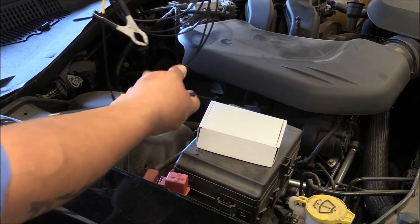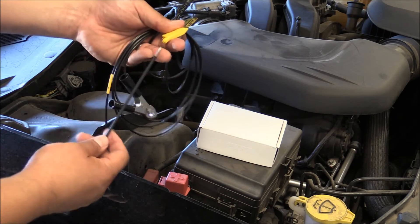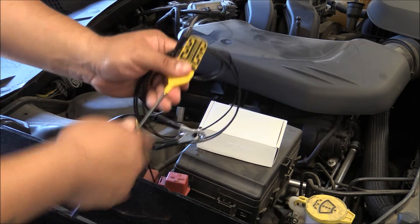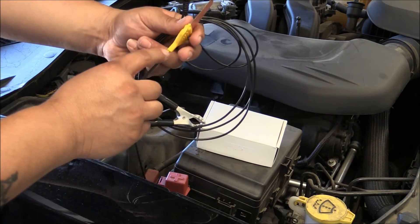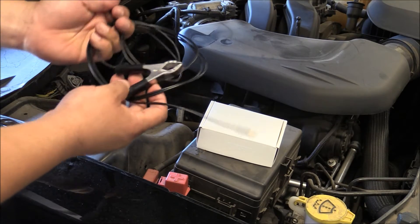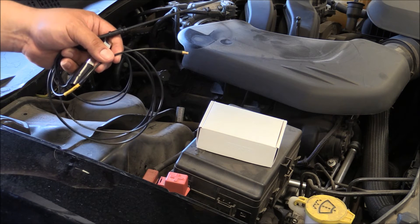Here's how we assemble it. You have your banana socket, which is interchangeable — it works with the paddle and the clip. The tip goes right inside the paddle, and you want to get it as flush to the heat shrink as possible to eliminate any exposed metal. The other end plugs into the banana plug. We also have the ground clip on the other end — make sure that ground clip is grounded in the engine compartment. This end connects to the U-Scope. Now let's go ahead and get the car turned on so we can start setting up the scope.